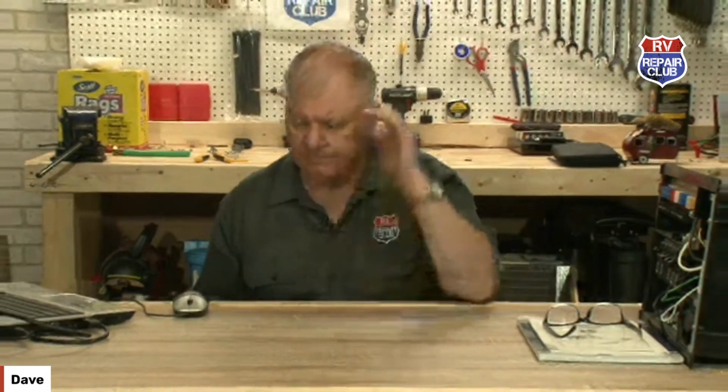It's a big problem with lead acid batteries. We've talked about this many, many times, that this old distribution center here is going to do 13.6 volts. And when it hits 12.6 in the battery, it drops down to 13.2, and it does not get rid of sulfation. So you can either get a solar panel that maintains it in the wintertime,